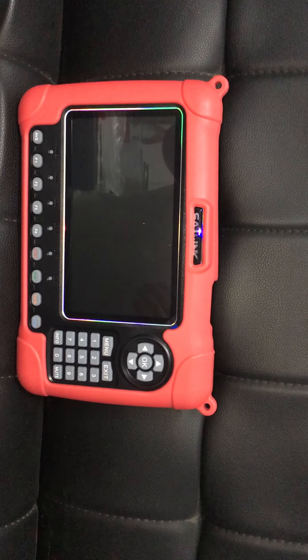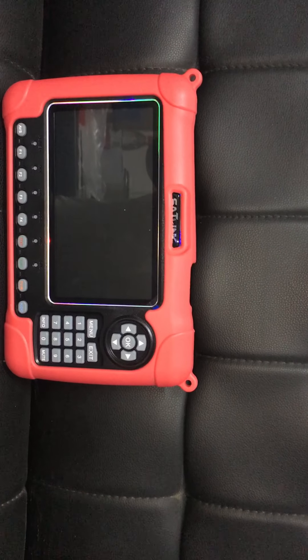To summarize: at your convenience, please check the battery and power adapter, try charging the battery directly via the AC/DC power adapter for 30 minutes, reinstall it and check if the device powers on, and use a smartphone to verify whether the battery has power. Some issue must exist on the device, and we are sorry for that. Thank you for your time watching this video — our colleague Lily will write to you shortly.